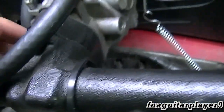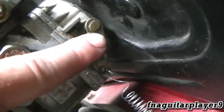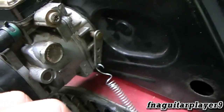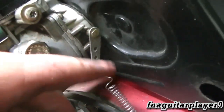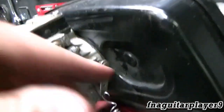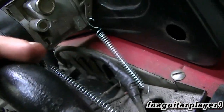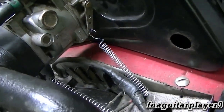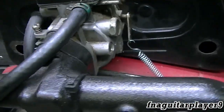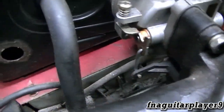Like I said, the simplest part of this engine is the choke. You'll notice there are three holes — it depends on how much your choke cable moves your choke control. If it just moves a little bit you can use that small one; if it's got more pull you can use that other one. This type doesn't have an automatic choke — I've never seen one with an automatic choke, it's always been a manual choke on these, and it's not like the single cylinder engines.